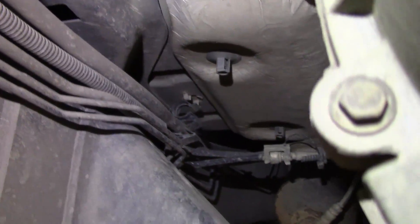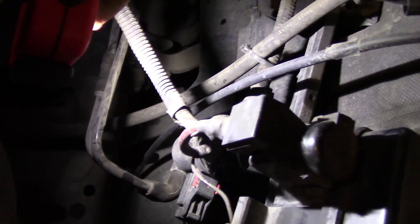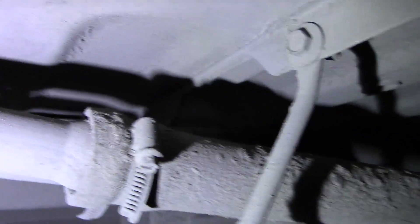There are a few things commonly related to this. First, vacuum hoses and EVAP system hoses — you want to check all the hoses in your system. This is a great time if you've got access to a smoke machine to disconnect purge and vent side hoses, fuel tank hoses, and fill pipe hose. Most people don't have access to one of those tools, so a close visual inspection is important. On these Dodge Ram trucks there's a purge hose that comes up the backside of the motor that's relatively hard to see, where it wraps around the back of the cylinder head and is prone to wearing through.